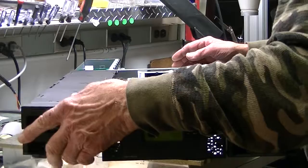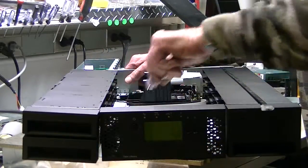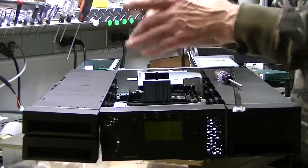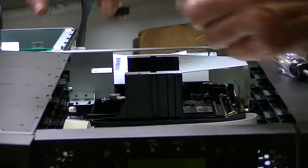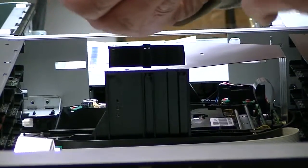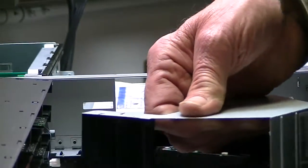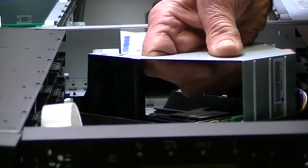On to the replacement of the picker. The first thing you have to do — this is a good time to get your cell phone out and take a picture down here. The first thing that has to come out is this clip. I've taken it off, and the orientation must be placed back correctly. This larger cutout at about 45 degrees needs to face the picker, because as it rotates, if you don't have it on right, it'll hit the picker.